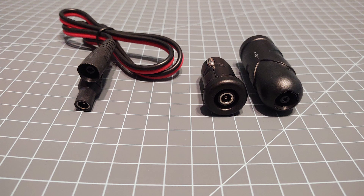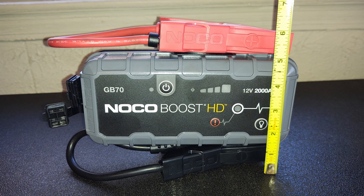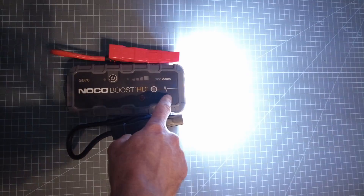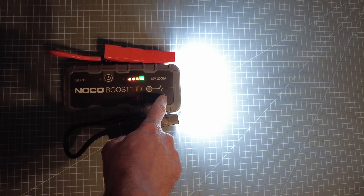This model's features include a 2,000 amp capacity for jump-starting dead batteries. It's able to be used on up to 8 liter gas or 6 liter diesel engines, and has the ability to do multiple jumps on a single charge. It has reverse polarity protection, so you don't have to worry about jumping the electrical system backwards and damaging any electrical components.